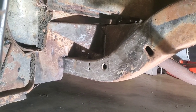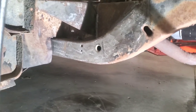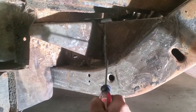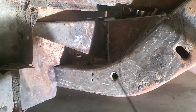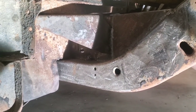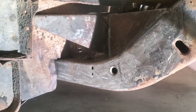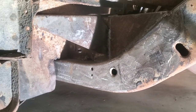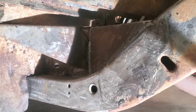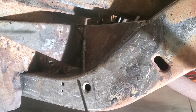What I usually do, which works for me, is by using the subframe you can leave all the stock body mounts and bed mounts when you try to slam these a little ways. I come in right past the original body mount here and just cut the frame off. These subframes have a rail that goes back for about two and a half feet, which will lay directly underneath the pickup frame. The original frames on these trucks are tapered — they're narrower at the front and they get wider towards the rear — but the subframe will pretty much lay directly on top of this rail from this point to the end.